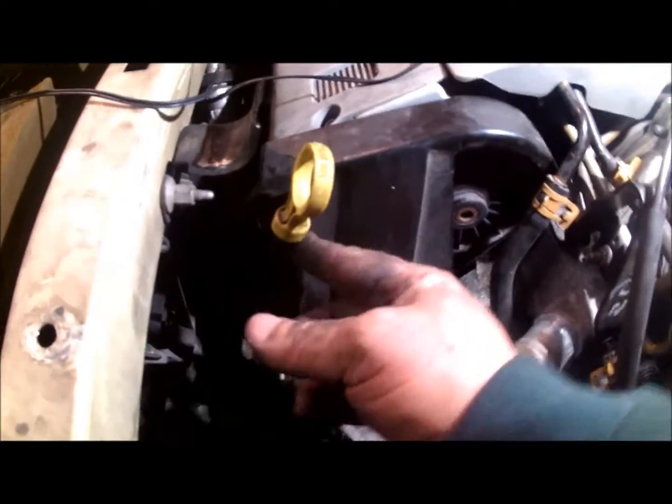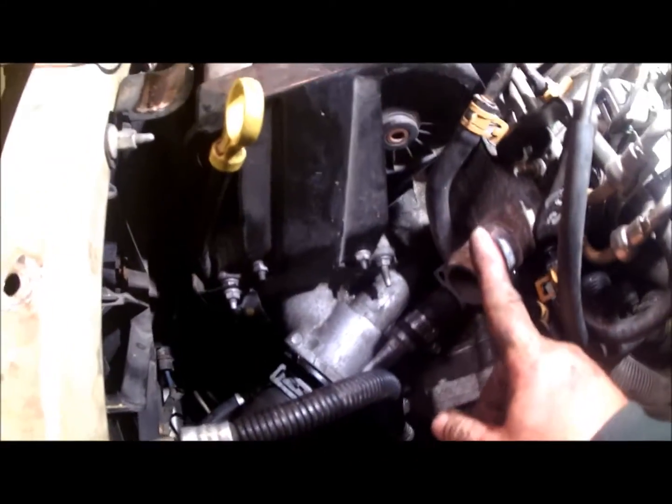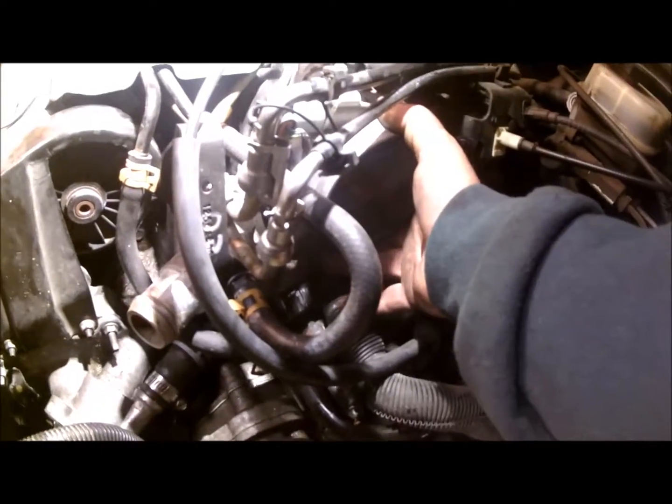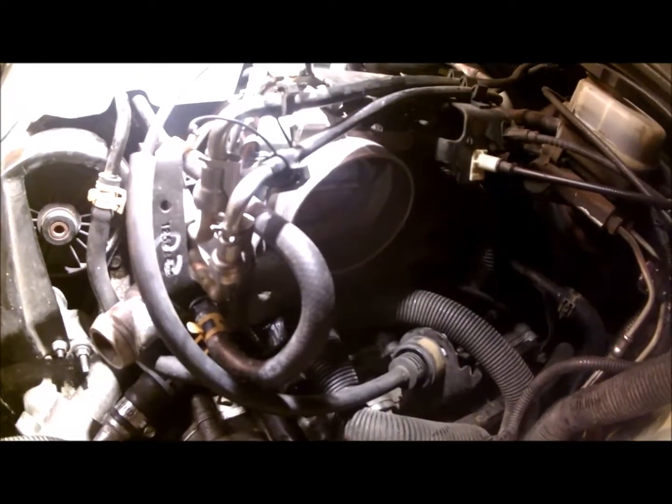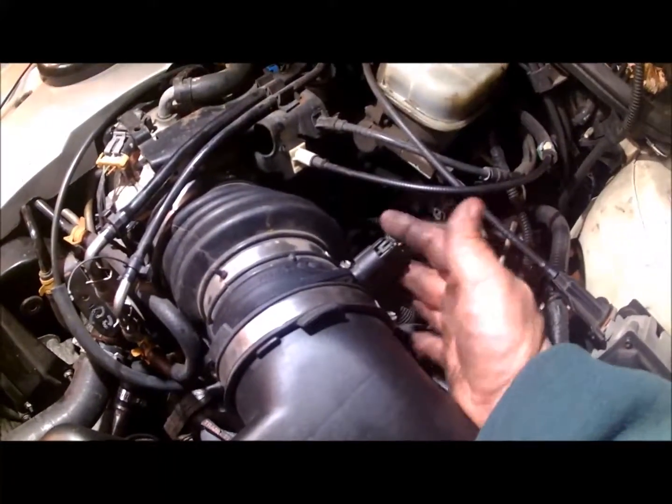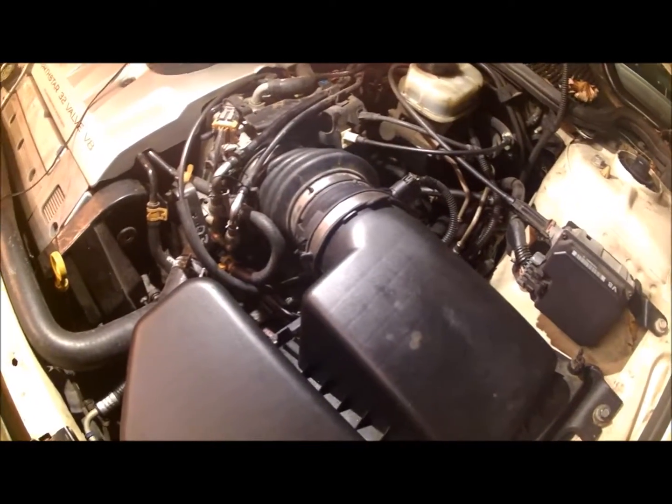Everything is tightened back up — the oil dipstick, that cover, the top hose — all done. I put the breather filter box back in; it has the brain box on the left side in the front, and the breather filter goes up with the hose that connects to the port intake. Once that's done, pour some antifreeze fluid in. The filter box is back on, everything's back in, plugs plugged back in. This completes the installation of a water pump for a 2000 Cadillac DeVille DTS 4.6 liter engine.